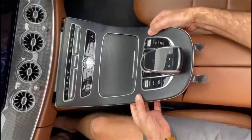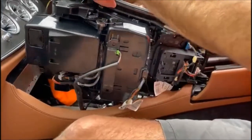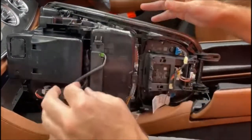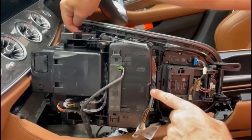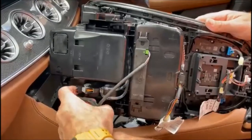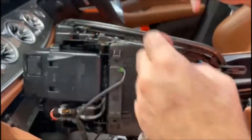You're lifting that up, and there is enough space here to tilt this over. Just put a microfibre cloth in the corner so nothing scratches. If you intend to replace the wood trim as I've done, you just need to work your way around the two light connectors, the three electrical connectors at the back for the switch row and the clock, the keyless module connector, and the harness for either the cigarette lighter or USB socket depending on what you have. Once that's out, all the other parts just clip in with quick-release clips.